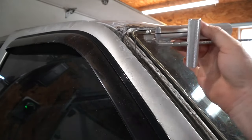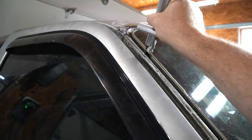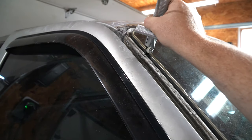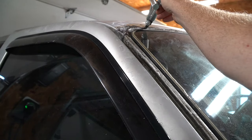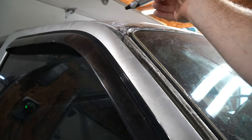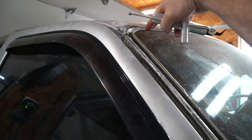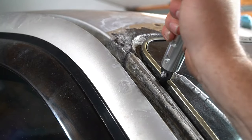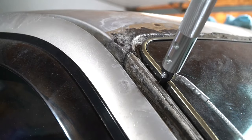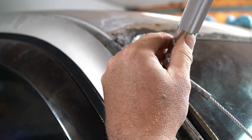One of the hardest things with this style knife is getting that first plunge done. Sometimes it won't fit between the windshield and the side of the vehicle — mine will, but some vehicles it will not. Sometimes you have to start in a corner or at the top of the windshield where the gap is a little thicker. On this vehicle I can work it right down in here, give it a twist, and get it started. You also want to heat it up with a heat gun to make the urethane a little more pliable. Work it into the edge, give it a good twist, then keep it fairly parallel — or tip the cutting blade just slightly towards the glass — and give it a good pull to start cutting.